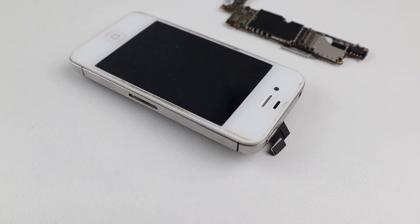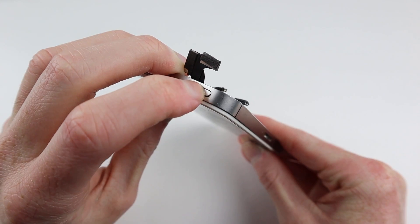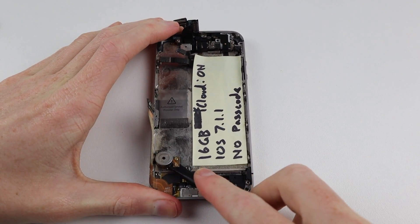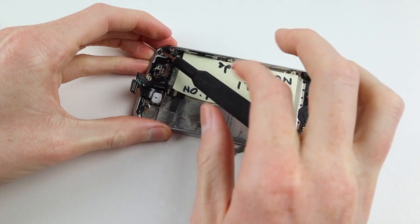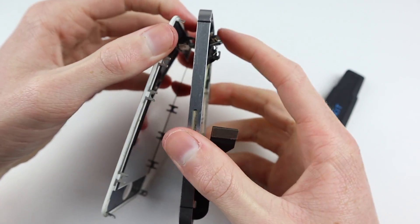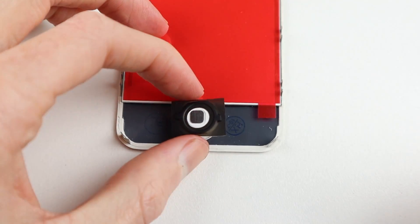It was time to restore this logic board into a housing with all its components to bring it back to a fully functioning phone. I grabbed an iPhone 4s frame from my parts bin. The screen has black blobs all over it so I'll need to swap in a new screen, and the power button isn't clicking so that needs replacing too. On the iPhone 4 and 4s you loosen the three screws on each side of the screen assembly plus one in each corner. The screen comes off and I prepped a new screen with a new home button and home button gasket, making sure it's straight, then peeled off the protective film.